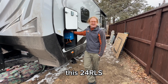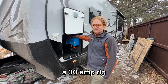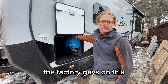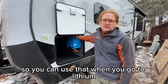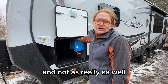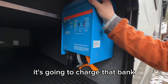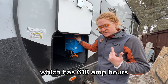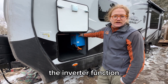This 24 RLS, and most Outdoors RVs under 25 feet, are all 30-amp rigs. We used the Victron MultiPlus original, which is an inverter-charger — a really, really good charger. The factory converter on this has a lithium switch so you can use it when you go to lithium, but it's only going to charge those lithium batteries at 30 or 40 amps. This Victron is a 120-amp charger, which means it's going to charge the bank at three times the rate of the factory converter — which, for this customer with 618 amp hours, makes a really fast charger super important.